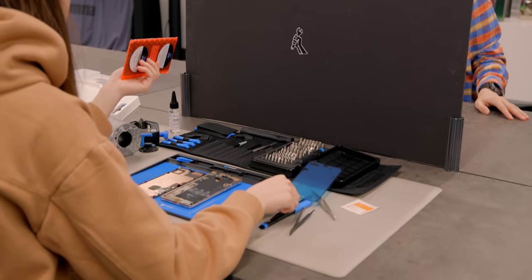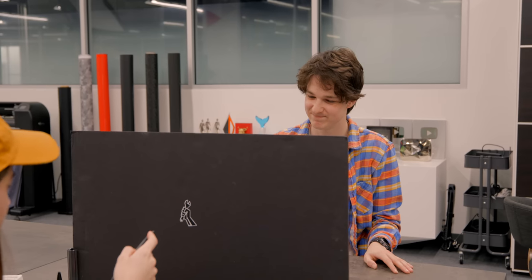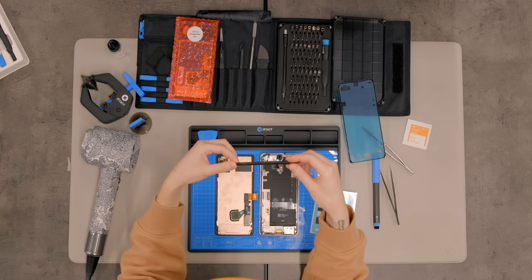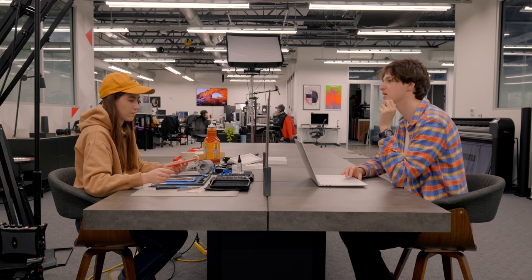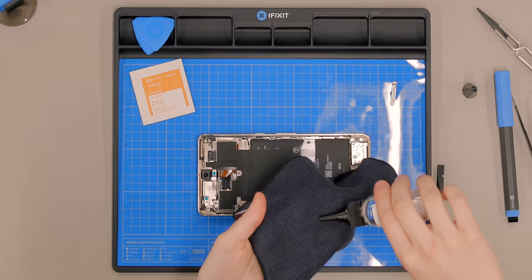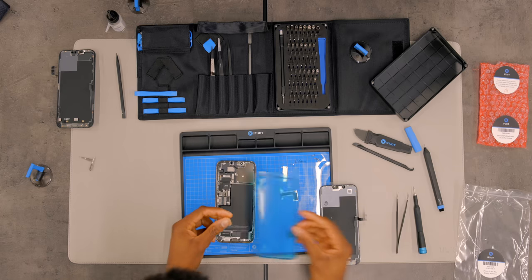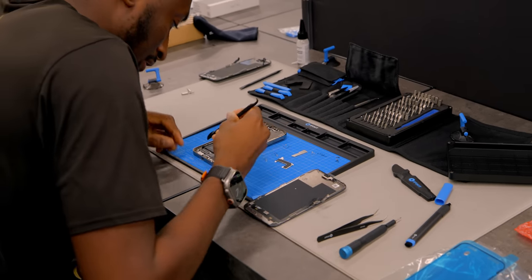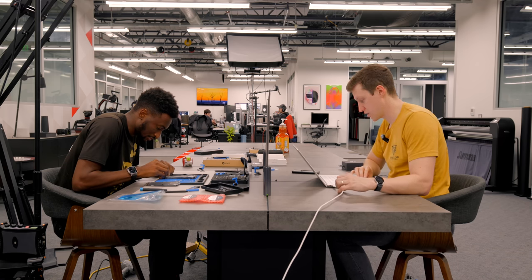Is there a chisel-like tool? Use the flat knife-edged tool — not the pointy pencil one — to scrape off all the excess adhesive around the edge of the phone. Then it's all off. Next, use your pliers and spudger to pull out the old adhesive from inside. At some points you might be able to grab a little piece with tweezers and pull, but if it breaks, scrape it up with the spudger.